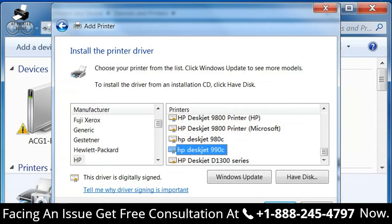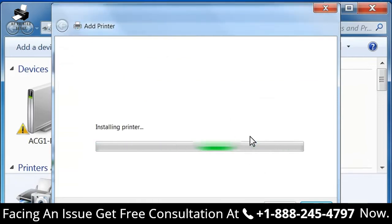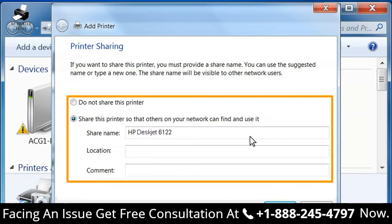After selecting a printer, click Next. The Type a Printer Name window opens. The Printer Name text box shows the name of the printer you selected. If you like, you can type a different name. Click Next. When the installation is complete, the printer sharing screen might open depending on your Windows settings. If the printer sharing screen does open, make selections about whether to share your printer.